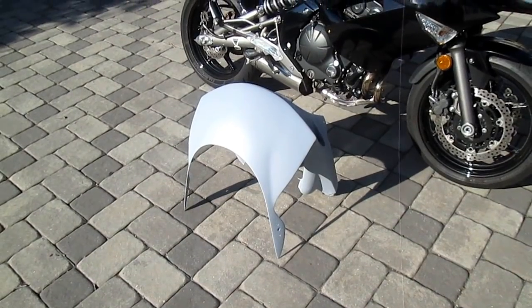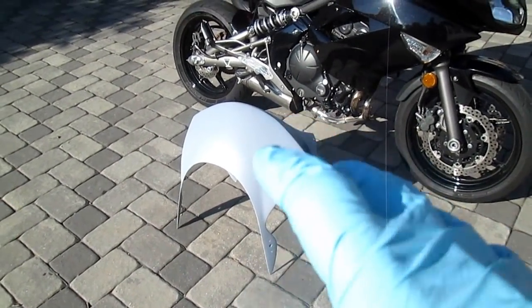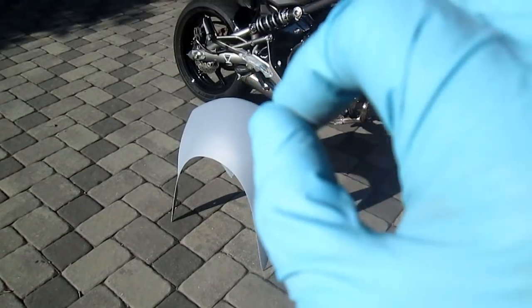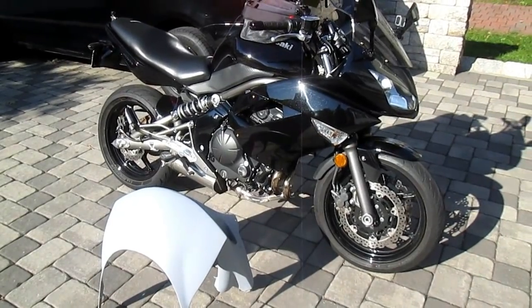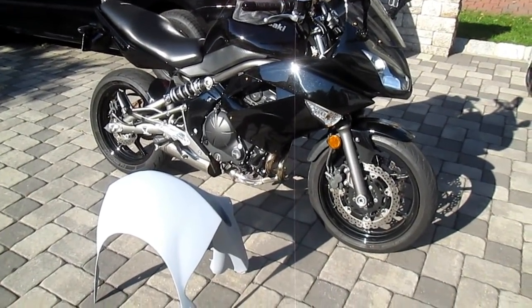And the main thing is this paint is going to be drying. Now, if we wanted to, we could put the white on this afternoon, but I want to sand this coat of primer, wet sand it, reprime it, and then put the white on another day. I don't want to rush the project. It also gives me a good excuse to go take a couple hour ride. We have about a 3 hour window here. We'll get some nice riding in. The leaves are changing.